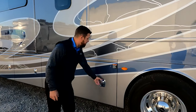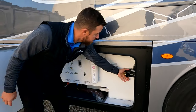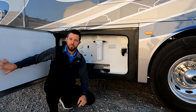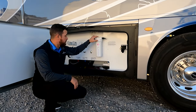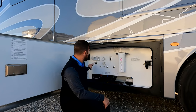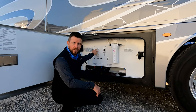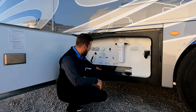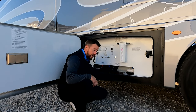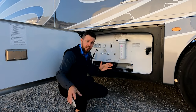We passed the badge reminding us we have V-Ride on this motorhome, and then into our utility bay. This unit has a 50-amp electric power cord. There's a hole routed in the bottom to run the cord out while keeping this compartment locked. We have a whole-house water filter — change it every 8,000 gallons — a water pump switch for the exterior shower, low point drains for winterizing, Sani-flush to keep the black tank cleaned out, knife valves, the main valve for the 100-gallon fresh water tank, and our black and gray tank valves. Always dump the black tank first, then use the gray to flush the system.